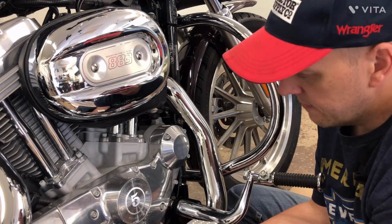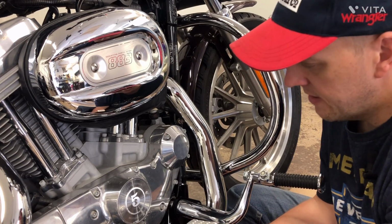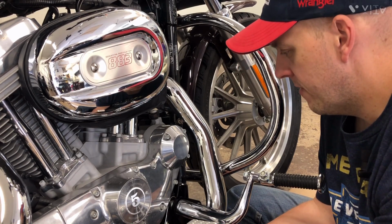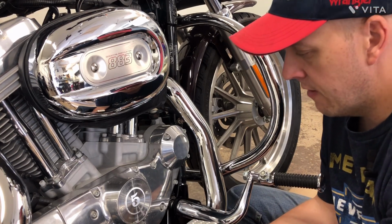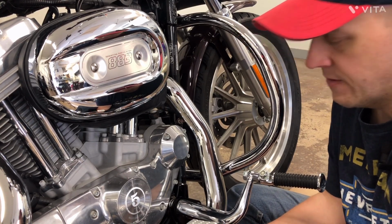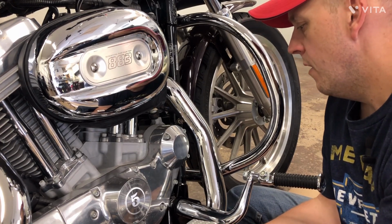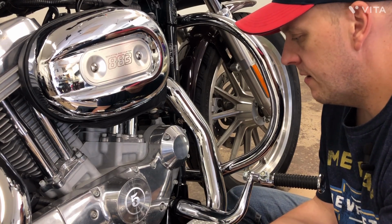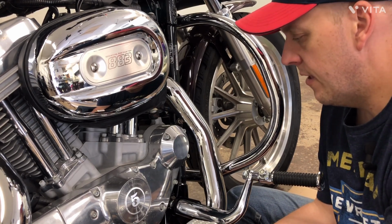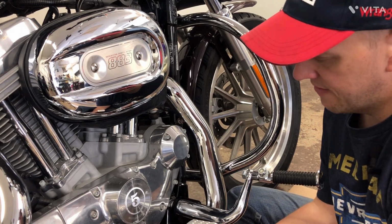Like I said, this bike was leaking gas when I bought it, and the previous owner did not know how to fix it. He had JB Weld just smothered all around the fuel coupler, and how the fuel line attaches to the fitting on the gas tank. It worked just like your pneumatic air hose for your air tools. So when I got it, I went and took everything apart, got all the JB Weld off, just took it to the wire wheel that took it right off, and had to take the gas tank off because, like I said, the low fuel indicator was stuck on, so I knew that sensor was bad.